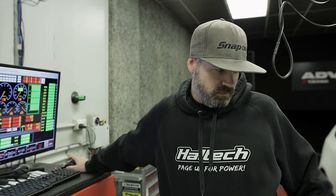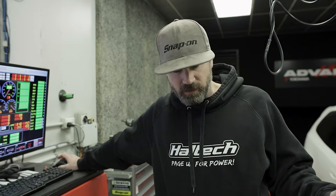The issues I found: one, the VVT cam angle for the intake cam on these, for the VTC, was not even set. Pretty much as soon as you start the car, it was requesting like 40 degrees intake advance, so the car wouldn't even start properly. Also, when you gave it a little bit of throttle, it seems to be in their purge valve mapping, for the EVAP. When you give it just a little bit of throttle, it's like the EVAP is stuck open and starts sucking in gas off the tank. So I took their default purge map that they have in the G4X and just made my own output, so that's a little bit better. Also, they weren't using any dual tables for the VTEC crossover map, which I always do, but that's all done.